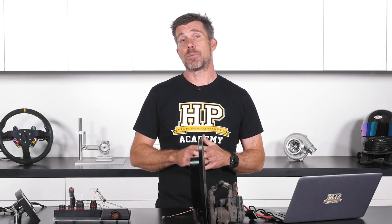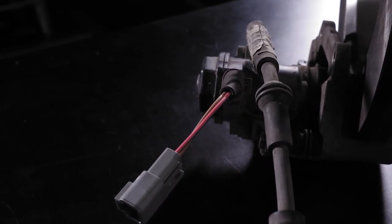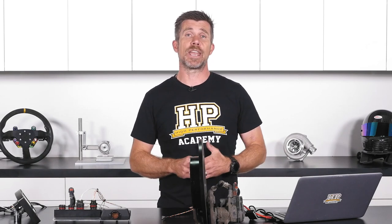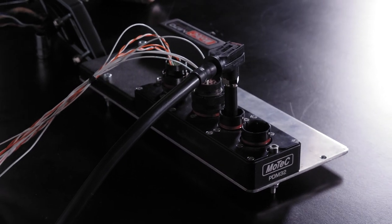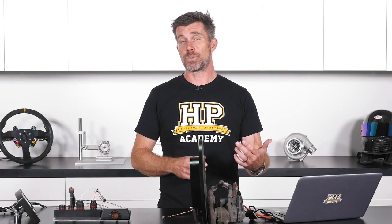Let's talk about the complexities. The Audi electric handbrake is a simple unit that incorporates a normal hydraulic pressure-driven piston as well as a servo motor that can drive the handbrake on and off. It is a two-wired device, and the complexity is that when the handbrake is engaged, one wire is driven to 12 volts and the other to earth. When we disengage, that is reversed. This allows us to drive the servo motor in either direction, but it creates a complexity with our MoTeC PDM32, because its outputs don't incorporate half-bridge outputs — each output will only go to 12 volts when active, so we can't switch polarity.